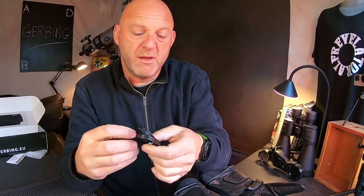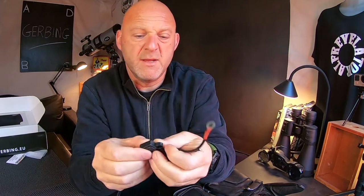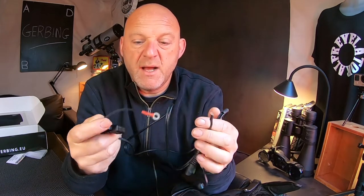Okay, this bit now goes into your wiring harness. Okay, so here is the wiring harness. So this can be connected directly to your battery. Okay, directly to your battery, and there's the fuse holder there, and then the other end here, that's what you connect this to, right? So you've got an initial battery power harness, then you've got the glove harness. That's it. So where you put this on your bike is going to be quite crucial. So let's say you've got your battery underneath the seat, you connect this up, but it's always going to be powered up. That's the thing, you're always going to have direct power to it. It's not switchable because it's directly to the battery, right? That depends if you want that or not.